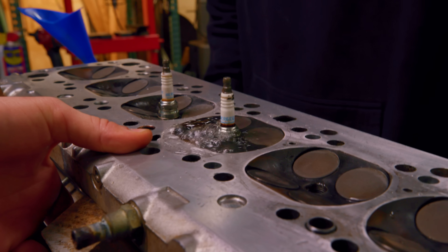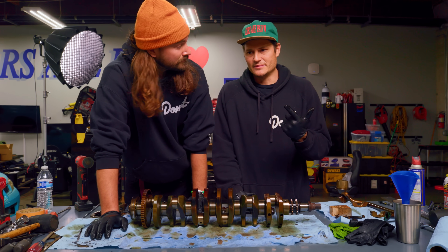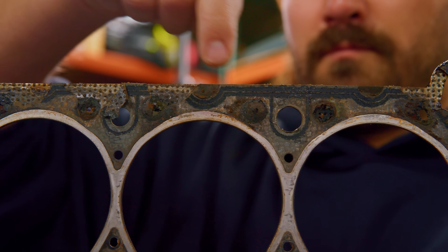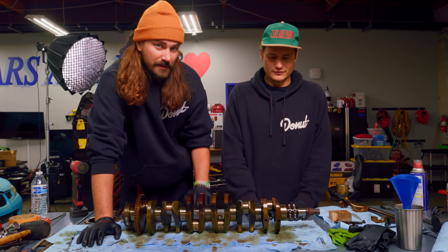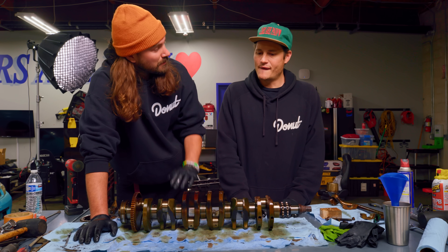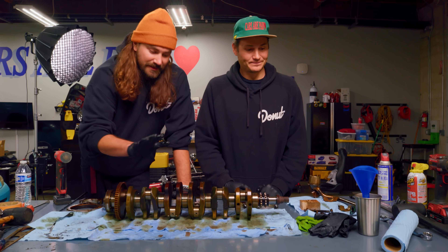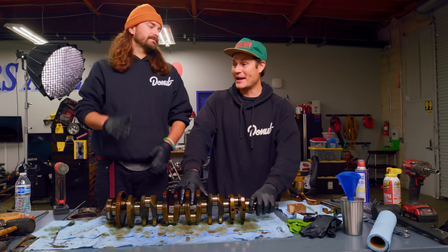So let's talk about what issues we really had. We had leaky valves on the intake and exhaust side — bad for making power and will help you overheat. We had warpage of the head and block mating surface, much more on the aluminum head which was out of spec. The head gasket coolant passages were also clogged, which contributed to burning valves, leaky valves sooner, and overheating the whole engine. If we skimmed the head, skimmed the block, and had the valve seats redone, we could put this thing back together. This is a great engine — took a beating and could keep on going.